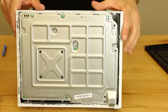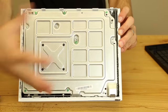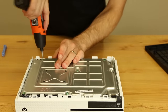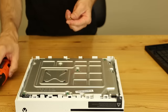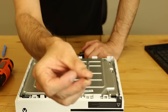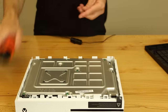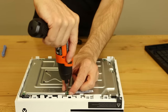Now what we've got in here is all these screws. We're going to take the green ones out first and that should let us take that out. I'm assuming they're going to be the T9 or T10. I've got a T8 on my bit and that's too small, so I've got to run and get my T9. The T9 — it is a security Torx, it's got the hole in the middle, so please keep that in mind. We're going to put it in our electric screwdriver and pull these out.